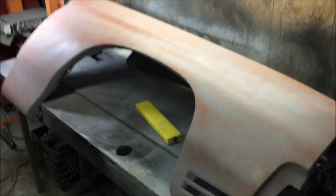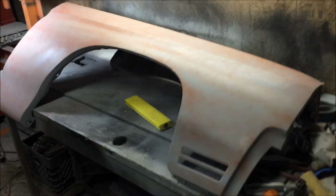But see, the fender's so damn big, it's hard to make a video. But I said bigger blocks. You're going to need bigger Durablocks, whatever. But you kind of get what I was talking about, how the blocks are just bigger. We're trying to square off more at one time, and you can see this has the same guide coat on it that the fender extensions had. It's the same process. 3 more coats of primer, got a guide coat on there.